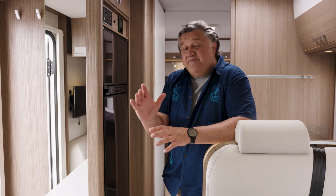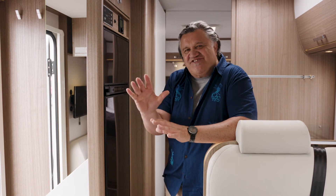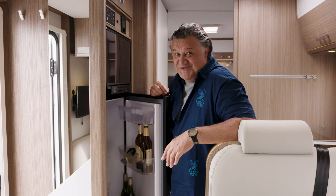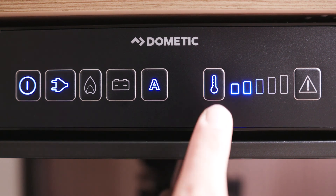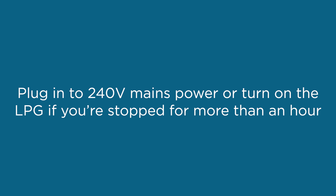There's nothing better than kicking back with a cold beer or a slightly chilled wine and some tasty New Zealand cheese as you watch the sunset. You'll need to know how the fridge works, otherwise your beer will be warm. Turn on the fridge by pressing the power button. Press the button to select A for auto — the automatic sensor will select the correct energy source. The power plug symbol indicates 240 volt mode, to be used when you are plugged into 240 volt mains power. The battery symbol is house battery mode, to be used when driving. The flame symbol is gas mode, and can be used when parked with the LPG bottle turned on. Press the thermometer button to cycle through the cooling level options — 5 bars is the coolest setting. If you stop driving for more than an hour, you must plug into 240 volt mains power or turn on the LPG bottles. The temperature of the refrigerator will start to rise without connection to a power source.